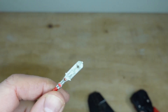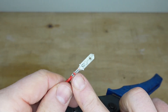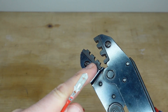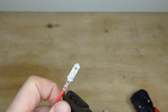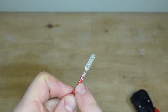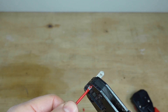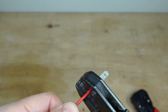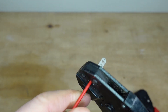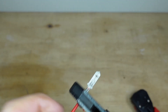If you use a larger connector in the wrong jaws, or the jaw is too small, you can take chunks out of the side and damage the connector. If the jaw is too large, it won't crimp far enough. Sometimes the rear tabs won't fully crimp, so you can move the connector forward to the next jaw size up — that may give you just enough crimp. Be careful not to damage the cable.